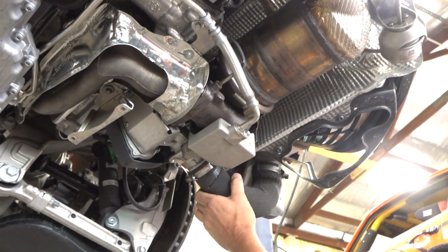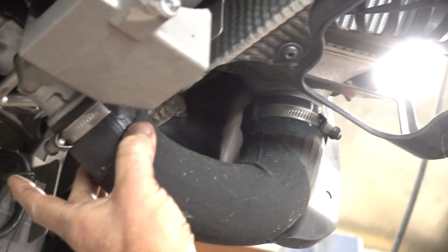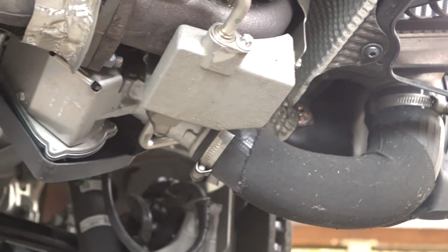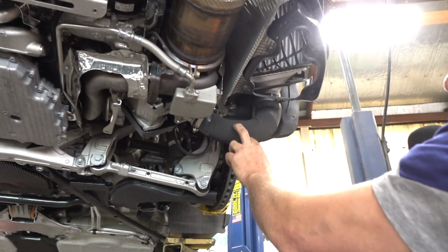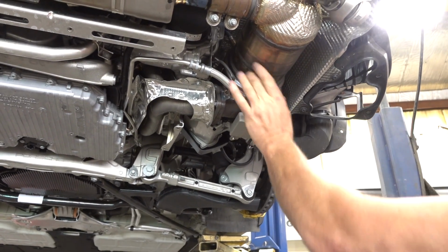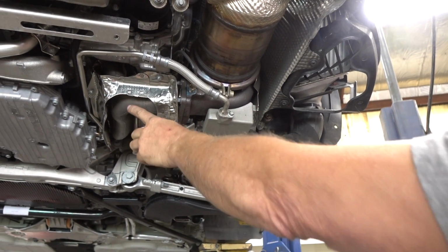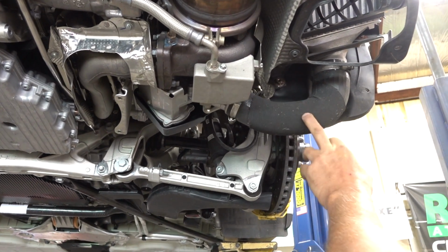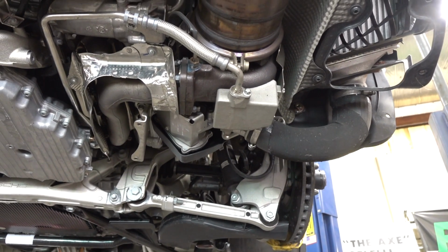Another piece that's worth noting is the compressor discharge going to the intercooler. On the road car, the 911 turbo, this is about a 52 millimeter, and on this car, this is like 65 millimeters. It's a massive hose. So what that does is it changes the compressor efficiency. And so by changing the exhaust efficiency, you're lowering the crossover pressure between the intake pressure and the exhaust pressure. And then by as well accommodating the compressor discharge, you're improving the compressor efficiency to take advantage of having this huge turbocharger. And it really is.